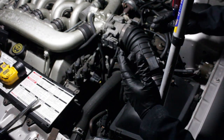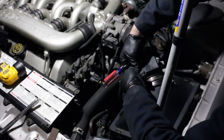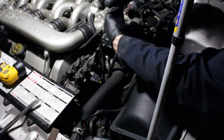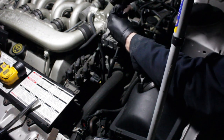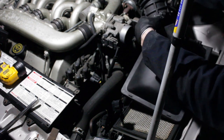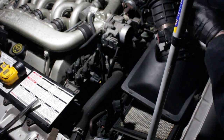This is a period when cars are a little more simple — just pop off the MAF airflow sensor here. Two regular screwdriver clamps — I'm probably just going to undo this one here and pull it off the throttle body. That unit just pops right off. What's awesome is this is actually pretty solid rubber, not hard plastic which would crack more over time — that's a good design cue. This old rubber lasts a lot longer than plastic under the hood.